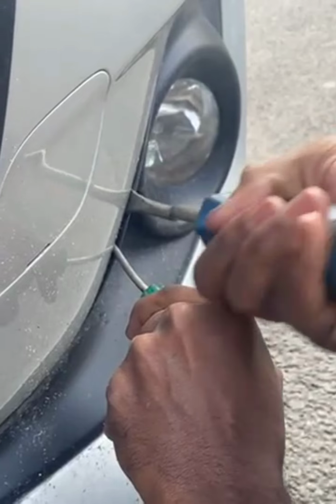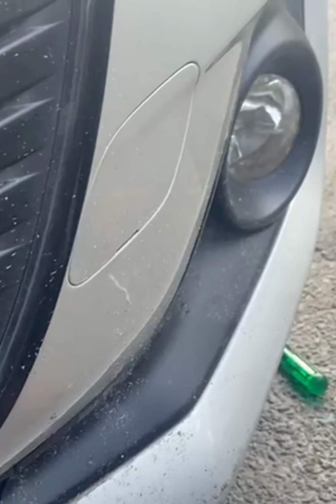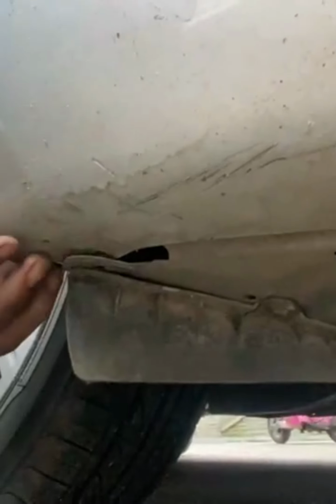We initially tried to open the front covers on the bumper just like on the previous model Swift, but we couldn't do that since the bumper is a little delicate. So what we did is we just pulled out the pins right from the bottom of the front bumper. This gave us enough space to put our hands inside and change the LED bulb. Let me just show you. Let me pull this cover and show you how it looks.